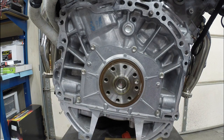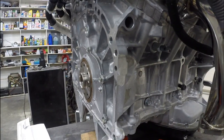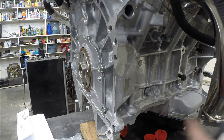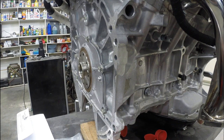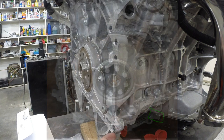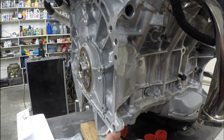Starting here on the right-hand side, right down here is going to be a roughly three-quarter inch chunk of aluminum that just sticks out — it's just a square block. You can cut that off almost completely flush with the block. You can see above and below where the original casting is; you can simply cut that down and grind it flush.